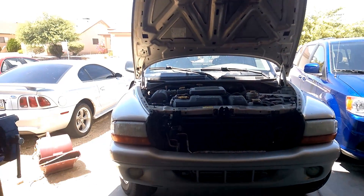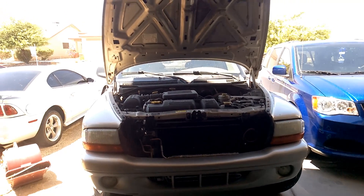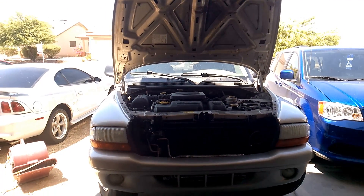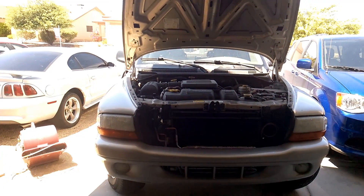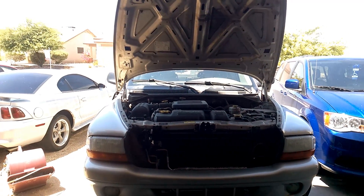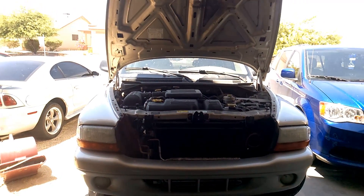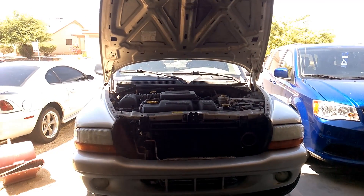Notice that when I have my gauges on, the suction's always kind of up there a little bit. The charge — I've dialed it in so many times, per the weight, which is like 2.44 pounds or something like that. This is a dual EVAP system — it's got the front and rear. I had my friend who used to have one of these, and several people tell me that the Durangos are just like that.